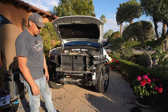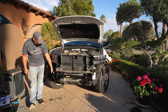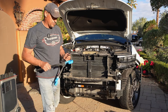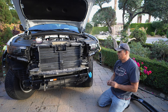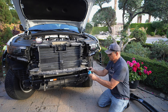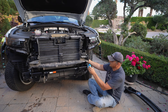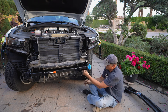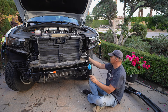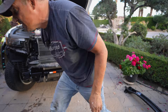Now we're going to start putting all the components back together. I've attached the horn on both sides and our pedestrian sensor on this side. The next thing is to reattach all of the tow hooks just like we did when we took them off. These tow hooks actually come with a new set of bolts because they're not attached to the front bumper anymore — they're attached to the base plate — so they've got a lock washer and a nylon nut. Putting the tow hooks back in: they come with a new set of bolts and nuts. We got the bottom one, which is kind of complicated — you thread it through the frame — but otherwise rather straightforward. Just got to tighten up the back nut again, and then repeat on the other side.